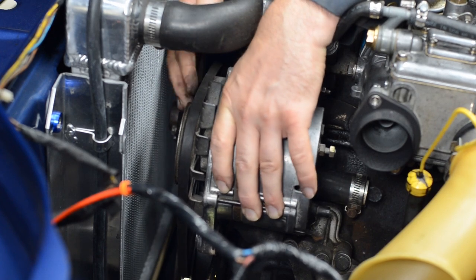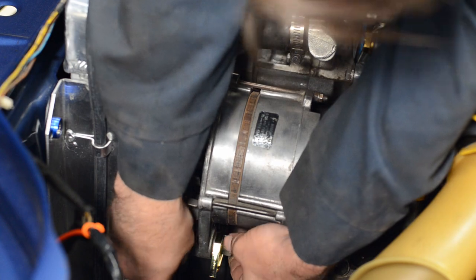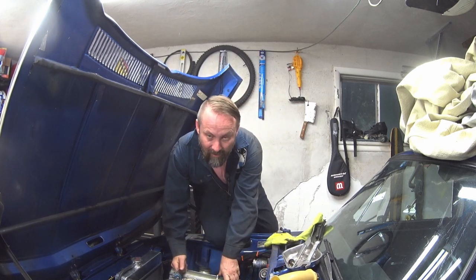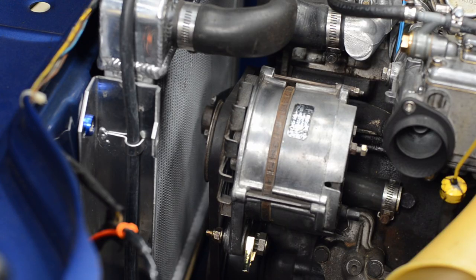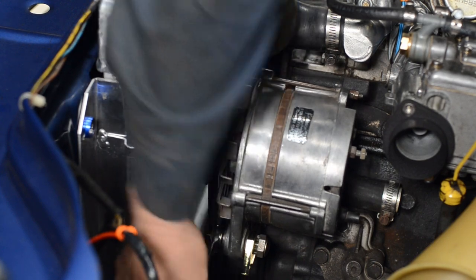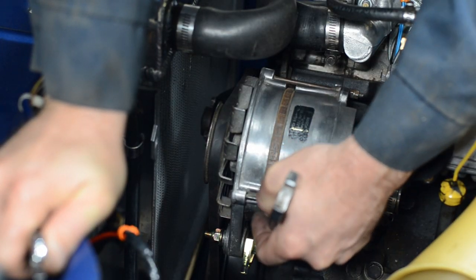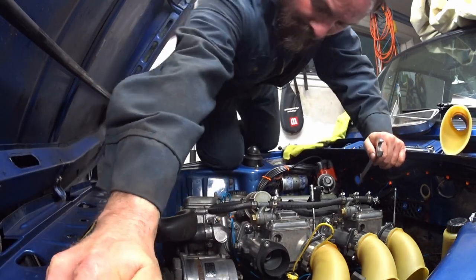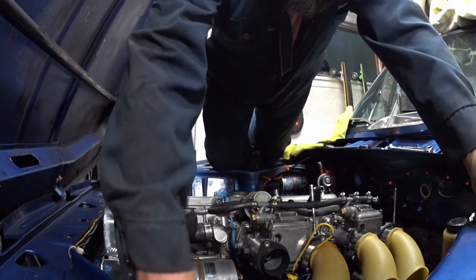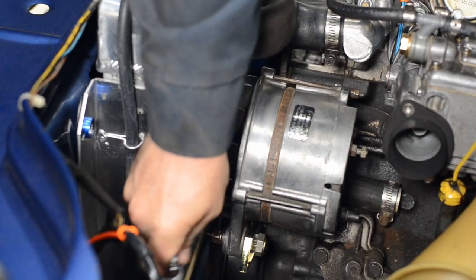What's actually super cool about this adjuster is that it tensions the belt as you tighten the nut to snug everything up, so it just kind of naturally finds a good tension — it's pretty neat. Just take this 19mm and crank it a bit tighter, feel the belt tension — that's nice. Should be able to tighten everything up.